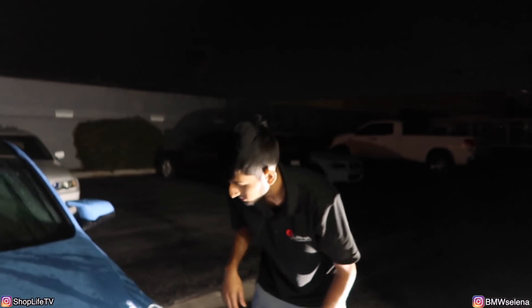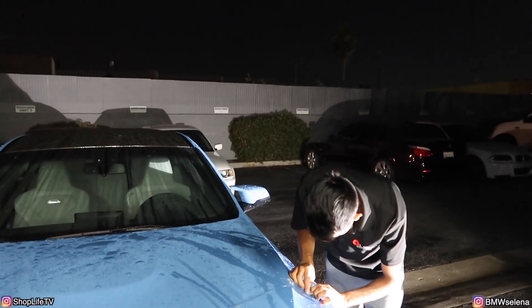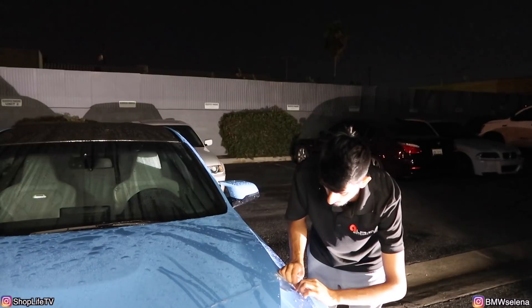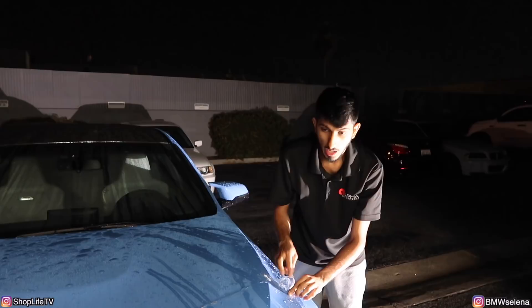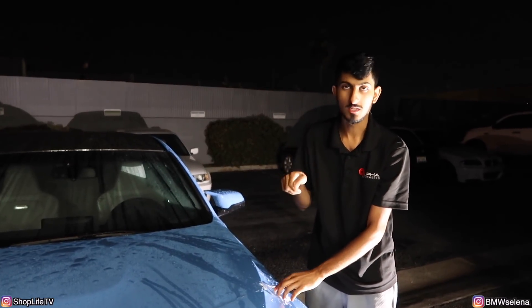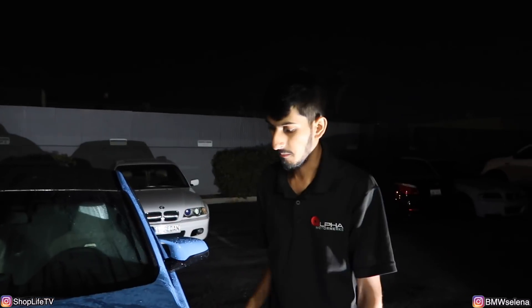So here's my question - now that you're taking it off with the pressure washer, do you think people who AutoFlex their whole car can still wash it with a pressure washer? You can definitely wash it with a pressure washer. The only thing is I'm trying to find a spot to lift it and then angle the pressure washer underneath to peel it up. Also, we did this with rattle cans - I would never suggest doing what we did with rattle cans for this big of an area. For just headlights or grills, that's fine. But for a whole hood, definitely don't do it with rattle cans - not enough product comes out.